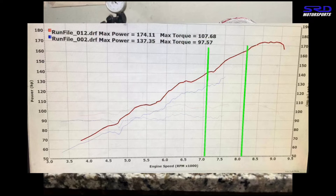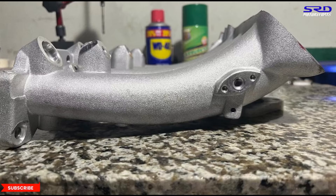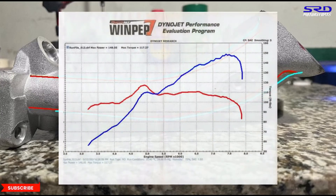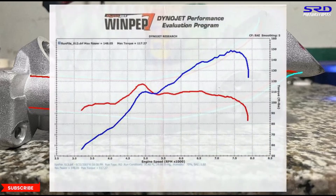From 7,000 to 8,000 RPM is where the third harmonic works really well for the engine — it's perfect for B16, B18, or B20 on CTR cams or even bigger cams like Pro 2, because you don't lose mid-range. The D16 Skunk 2 intake manifold also has about 9 inches of runner length, so that's still 12.5 inches total induction length. The third harmonic is from 7,000 to 8,000 RPM — and on the dyno sheet, 7,000 to 8,000 RPM is perfect to make a D16 or SOHC run really strong. Skunk 2 knew what they were doing.